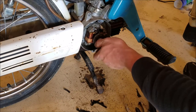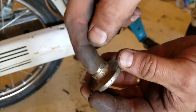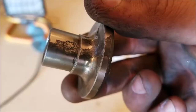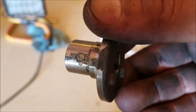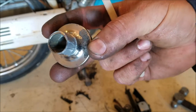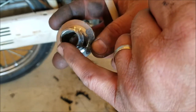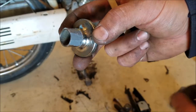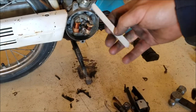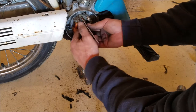There she goes — that is nerve wracking. See how that's all rusted? There's a big nasty spot where it glides, and that's going to make the points not work right. So after getting that rust off, it's a very pitted look — kind of deep on that spot. There it is with some JB Weld on it. You need to watch what you're doing if you're going to do stuff like this — it's a lobe so that the points will open, and this side is thicker than the other. So when I file that JB Weld down, I really need to pay attention to make sure it's not too high or low. I have my fingernail file here and I will clean up these old junky points.